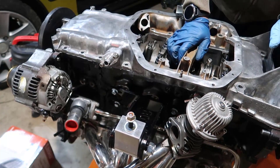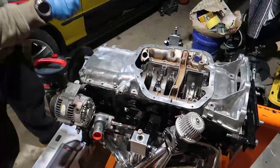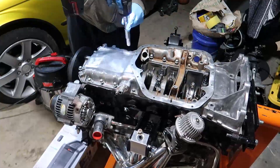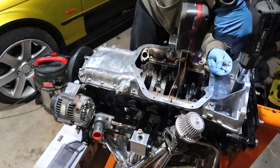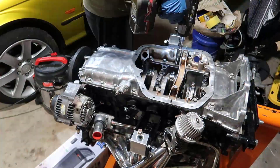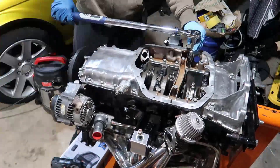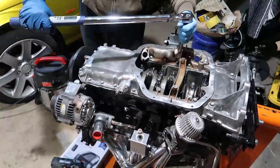There you go — wait five minutes so the gasket can cure a little bit and get thicker before putting the bolts on. I'm using the impact wrench so I can zap them quicker. I'm not using any torque with the impact wrench, just pushing them down.